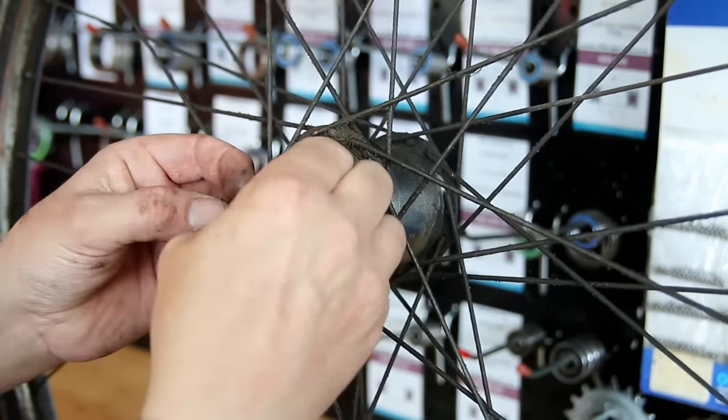I'm using thin oil on the pivot points to eliminate friction, then general purpose grease and copper grease on the threaded bolts so they actuate nicely and remain serviceable. Same for the centre pivot point down by the bottom bracket. New brake pads going on — there weren't a lot of costs on this bike: bearings, the chain, the brake pads, and a cable for the three-speed Sturmey hub. Other than that, very very little cost involved — amazing what you can do with very little money.